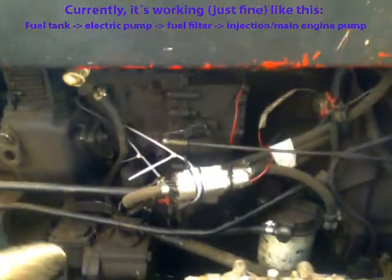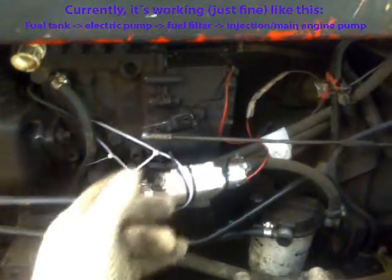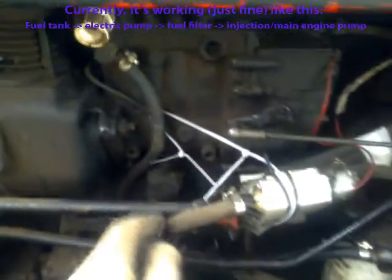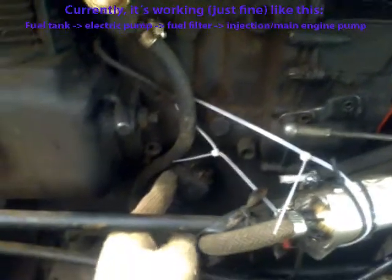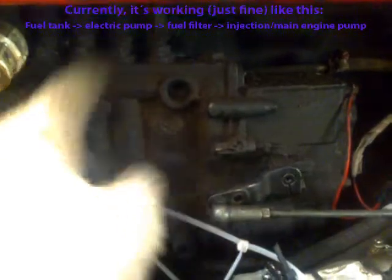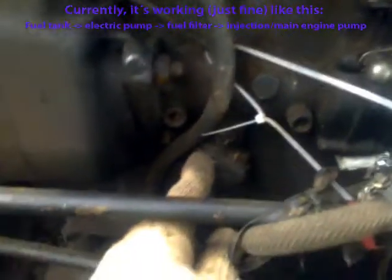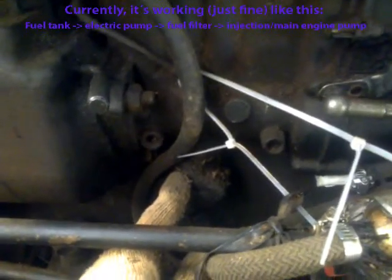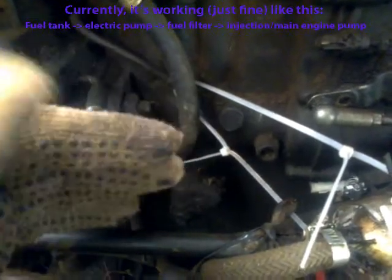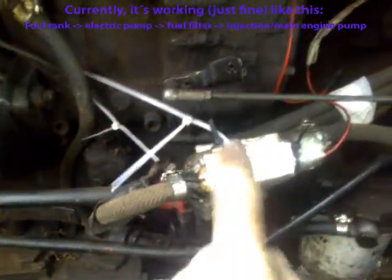All right. Over here is the new electric pump, old electric pump actually. I removed the lift pump which was originally here. Here's the diesel pump which goes to the main engine. This one always had the same problem with the diaphragm, that rubber inside, which made the pressure keep breaking off. So I completely removed it, and then the mechanics helped me out. They installed this electric one.